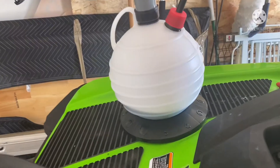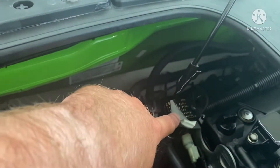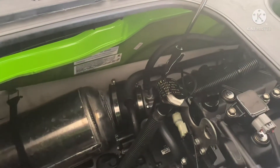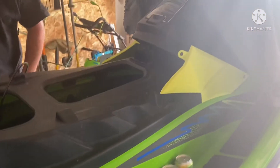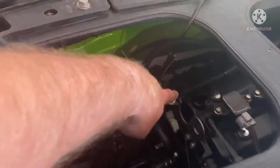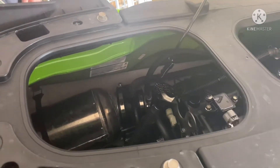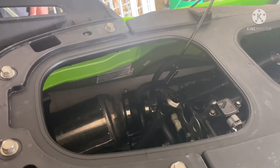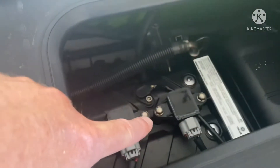Sometimes you can run the engine and put flush water through here, get it all up to temp and get the oil out faster. But what's the fun in that when you got beer right here? If you are wanting to preheat everything, just make sure you're adding flush water, run the engine for a few minutes with water on, and when you kill your engine make sure you shut the water off — you definitely don't want to flood this bad boy.